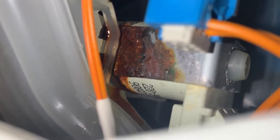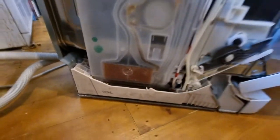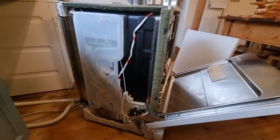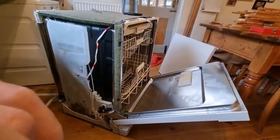If you've got an issue where your anti-flood is dripping, it might be a good idea to check the valves before you call out Miele for an expensive repair. On the left side you've got your dispenser, your reed switch, and your valves. If they are leaking and you are getting an anti-flood error, that's the first place to check.